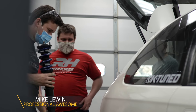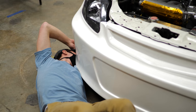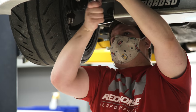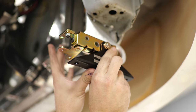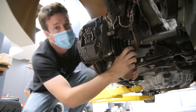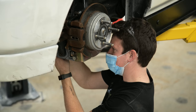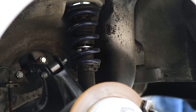My name is Mike Lewin from Professional Awesome. My name is Dan O'Donnell with Professional Awesome, and we're working on Ben Thorne's Honda Civic hatch. There's a lot more that goes into aerodynamics than you might think. It's extremely important that the front and rear downforce are equally matched — too much front downforce and the rear of the car will actually lift up. Professional Awesome is here to take measurements, check my suspension setup, weight balance, and existing aero mods to make sure we create a front splitter that is perfectly balanced for the car.